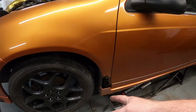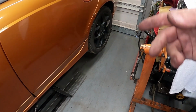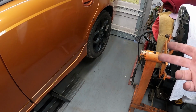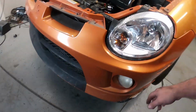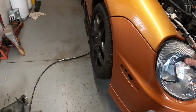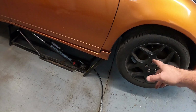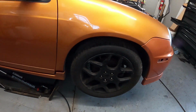It definitely should have brakes. Definitely should have a fender. It's got rust issues throughout it. They're all things that are still going to need to be addressed. It has uneven wear on these tires. It's missing a side marker. I don't know what's going on with these fog lights. These headlights should be bolted in. The inner edge of this tire is worn. We have more rust back there.